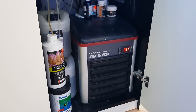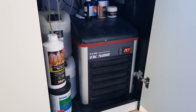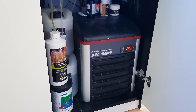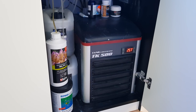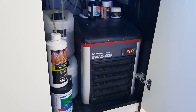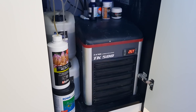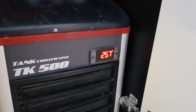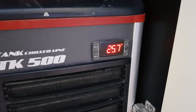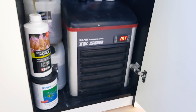This one is by a brand called Teco — this is the Teco TK-500, which is able to cool tanks up to 500 liters. This tank is around 500 liters, or 140 gallons, so it's sufficient and does the job very well. I've been using it for nearly two years — I bought it in the summer of 2016 and it's been doing very well since. I just leave it running all year because it has an integrated heater, so it's monitoring the water temperature 24/7. You can set it using the controls — like most chillers, you can set the temperature and an offset for how much it needs to heat up before switching to cooling.